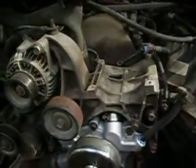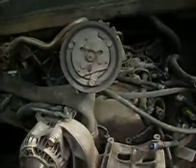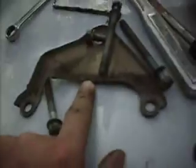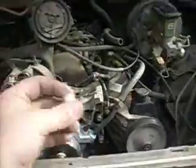As you can see, I've already got the fan shroud and fan out. I've got the AC compressor out. To pull that, you've got five bolts — three bolts in the back which hold on a triangular bracket. That's the triangular bracket right here. Short stubby bolt in the tail end, two longer bolts in the front end, and then one of the bolts that goes on the actual compressor. One bolt's still sitting in here. Those are all half inch socket.